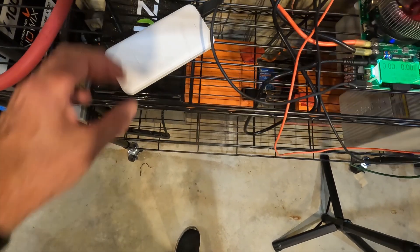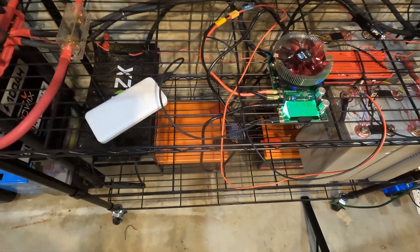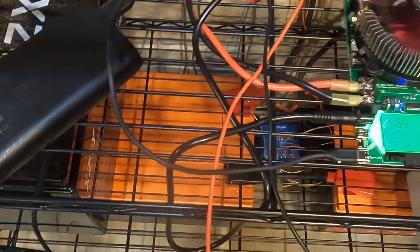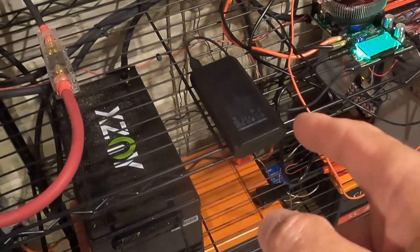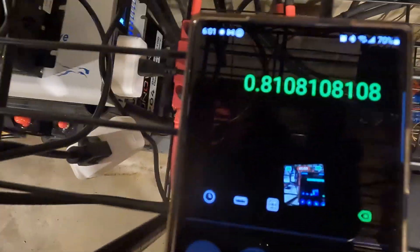This is only a year old and I've probably used it about 10 times, so there shouldn't be much battery degradation. We've got one more to go — the Belkin — and remember that one is about four years old, so we'll see what the difference is. The test has begun showing 4.89 volts at 1.03 amps. This is a 20,000 milliamp battery bank. The capacity test is done and it says 60.3 watt hours. This is a 20,000 milliamp bank, so that's 74 watt hours — it still has 81 percent of its capacity.